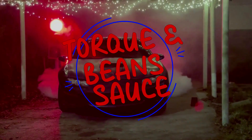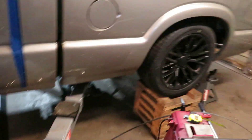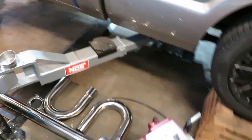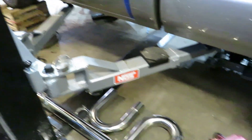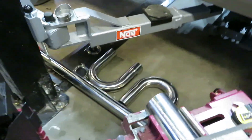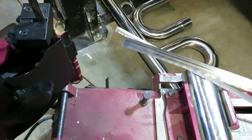Overdose of salt, you don't need to get salt. Alright, so working on cutting the exhaust, cutting some pie cuts with a band saw here. I noticed when I went to cut, the blade was hopping every so often, and I looked and I could tell that it was getting ready to separate at the seam — right where these two meet together, they're welded or seamed or fused somehow.